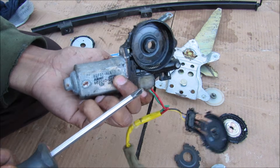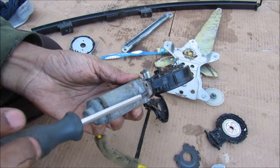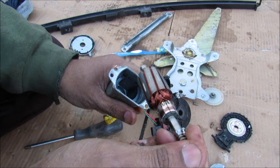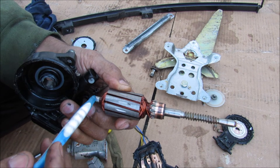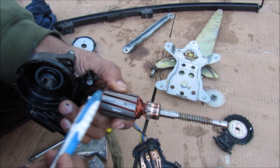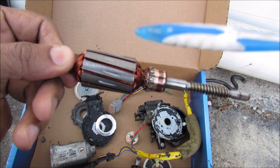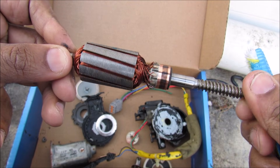Here's the final drive gear. Now with the casing fully stripped down I'm going to remove the three Phillips screws that hold the motor assembly on itself, and then I can remove this housing here and pull out the shaft. Here we have the motor armature with all the coils inside, and these three surfaces here act as bearing surfaces for this entire thing to rotate about.